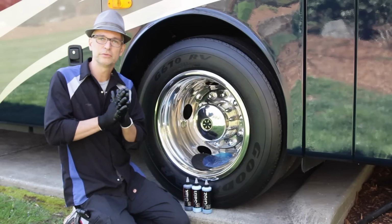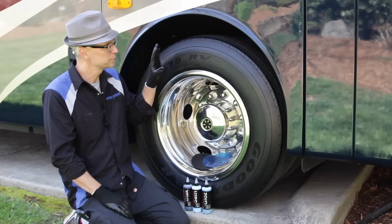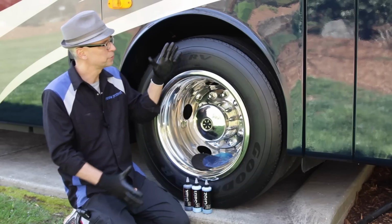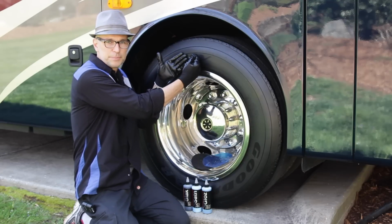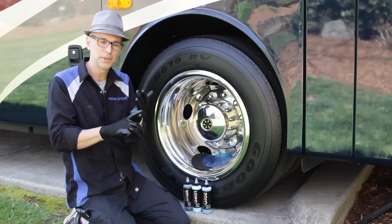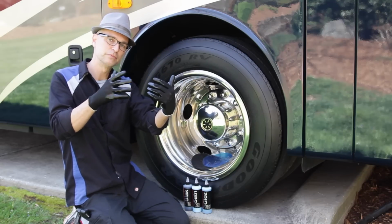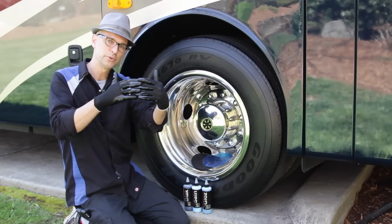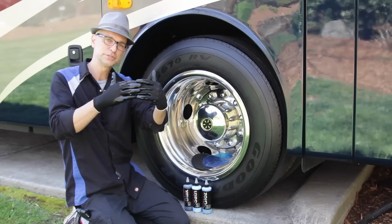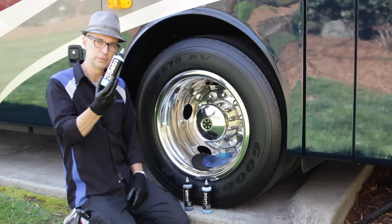Good options prevent tire dry rot. Like this tire is a 9-year-old tire and it's still in good shape. This receives an annual treatment of Renew Protect Black. There is no evidence of dry rot or cracking. And of course, dry rot is when your polymers, your bonds begin to break. Your surface becomes dry. It's what you see in the fading on plastic, and also you'll see fading on tires, becomes dry and pulls apart, which is a big issue for vinyl. The skin on the vinyl becomes dry, and the plasticizers, which allow the fluidity, the movement of that surface, are exhausted from the UV and the ozone and pull apart and break. Again, restore the plasticizers.